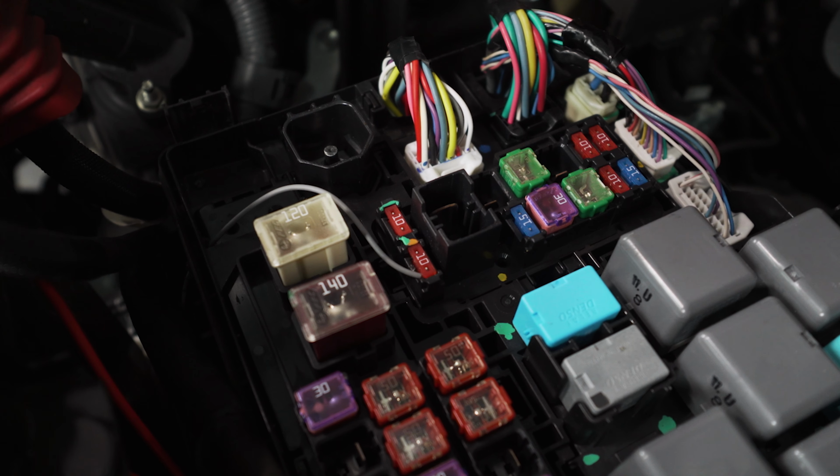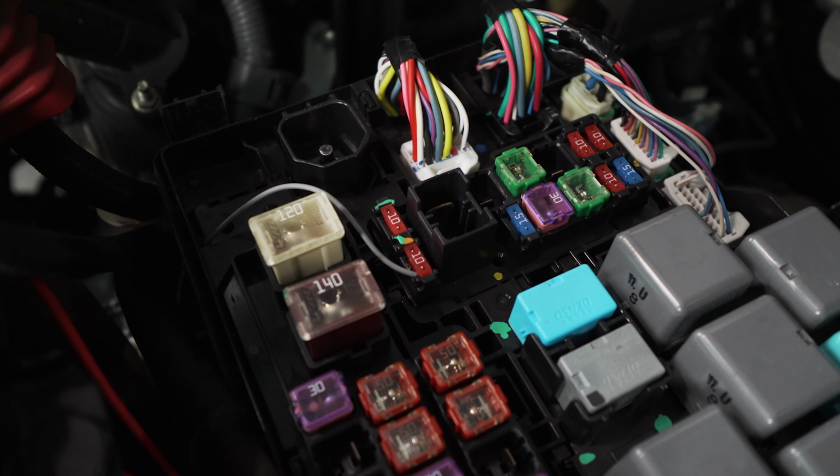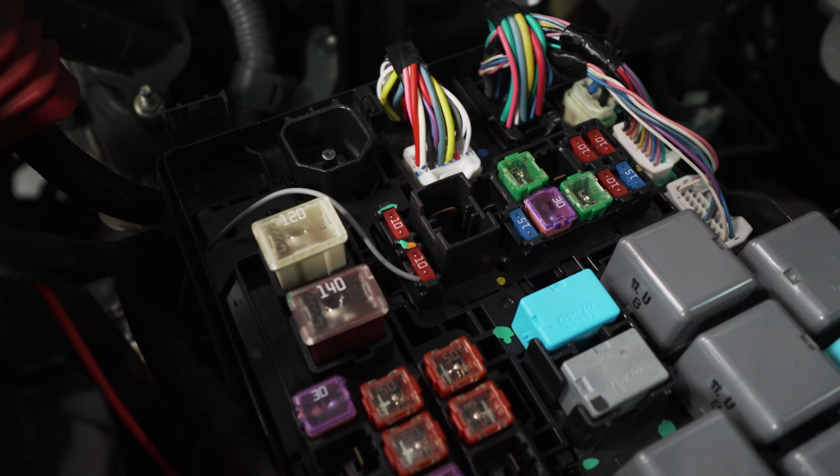Then moving back slightly further into the fuse box behind the battery, you're going to have one last wire to bring in there, and it's a skinny gray wire. There's only one like it in this harness. So you're going to tap that into the fuse you see here. And once you have that tied in, you should be pretty well set to go.